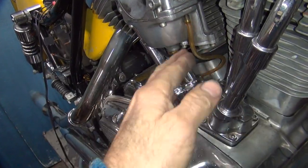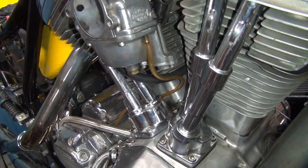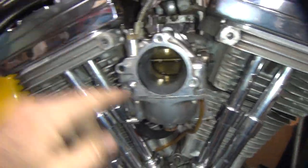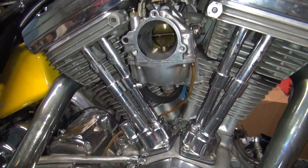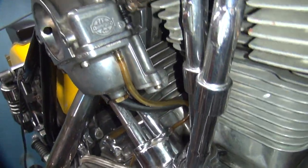So when you hit the juice, it started squirting down in between the gasket and started to blow out. The O-rings were fine. The squirter was squirting this way instead of this way — it has a hex head on top and you rotate it to make it where you need to be. Someone didn't have it in the right spot, so no leakage over here now.